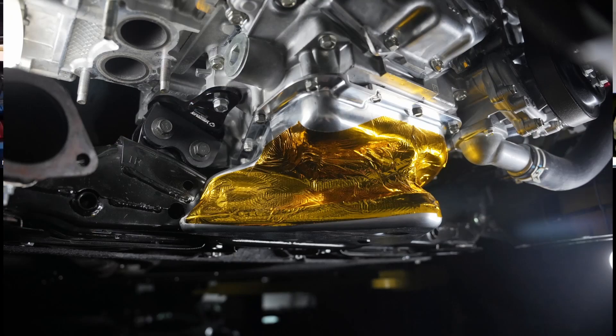What the people testing are doing is putting gold reflective heat tape between the pan and the headers, because you're trying to use all of the available space which goes right up to the factory header. That reflective tape does a pretty good job reflecting radiant heat energy. The other point is that there is definitely a correlation between oil temperature and oil pressure.